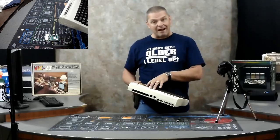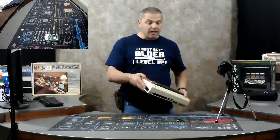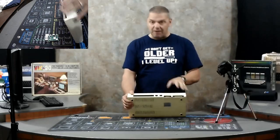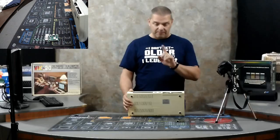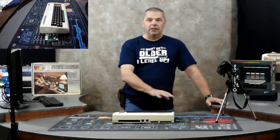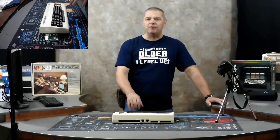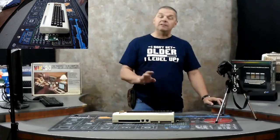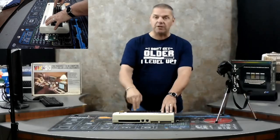We will maintain the keyboard and all of the internal wiring. We want the LED to work and we want the power switch to work on the side. Most conversions have one USB port coming out — one USB internally working the keyboard. But you always need external ports to add another keyboard. The Commodore keyboard, while very cool, is missing a lot of keys that contemporary keyboards have, so it's easier to plug in an external keyboard. A lot of games also require an external mouse, so we'll have a USB port available for that as well.